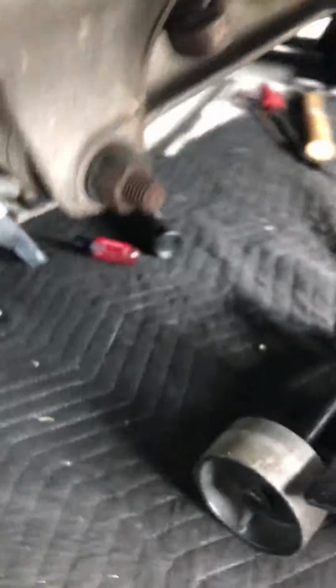So once you manage to get this half shaft loose, everything was rusted, so I had to bang it out. Once you manage to get it unstuck, you take out the caps from both sides to give it a little more wiggle room, and then you should be able to push it right over and out. And then after that, you'll have it loose. See, it's loose.